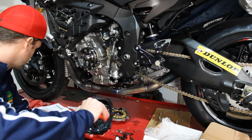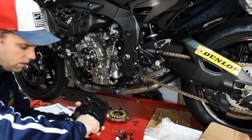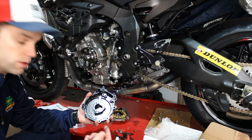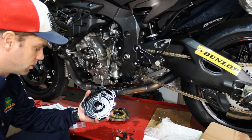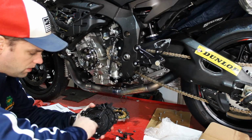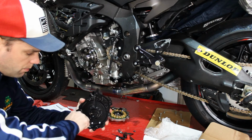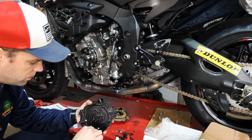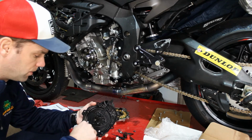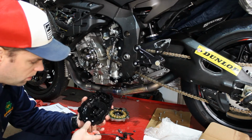We do not supply a torque spec in here, but one of the nice things about working on this stuff is that typically the tool will kind of tell you what torque you should be at if you don't have an actual torque number. So there is the old German torque spec of Gutentight, which is always a good measure, but you don't want to go too hard. You are screwing into stainless steel and not into aluminum like you would be with some of the cover plates. So aluminum strips a little bit easier than stainless steel does, but because these are only 3mm hex, you're only going to be able to put so much torque on them. And when you have a T-handle like this, you can actually feel that handle flex a little bit, the metal of the Allen key. So you say, okay, I'm pretty good.